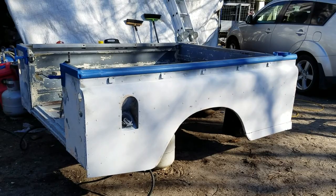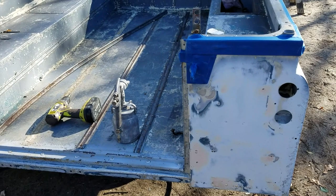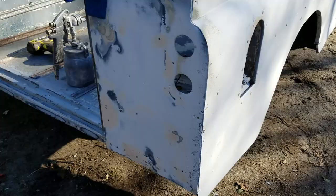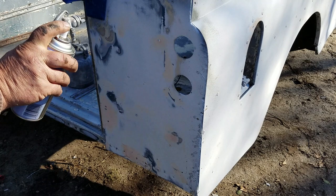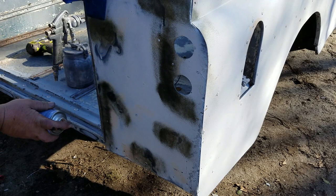It's the tail end of winter and my body tub has been sitting in the rain for about six weeks. I've managed to do a little bit here and there — it just needs its final coat of primer and a blocking back, and then the outside is ready to paint. I've done a couple of little scrapes of body filler over some scratches, sanded them back, and now I'm going to paint etch primer over them to make sure there's some primer over these patches to give the top coat something to stick to.